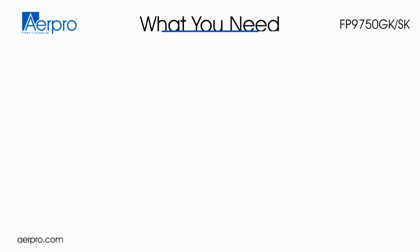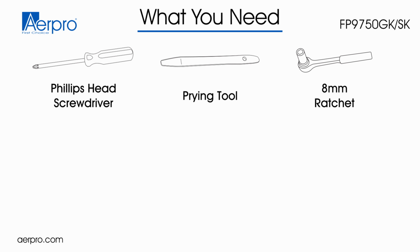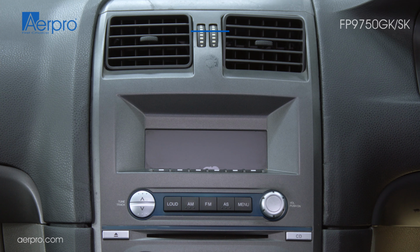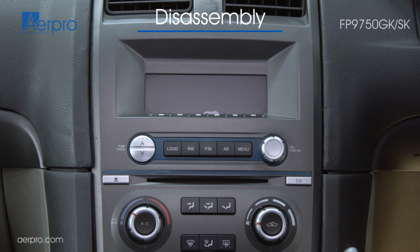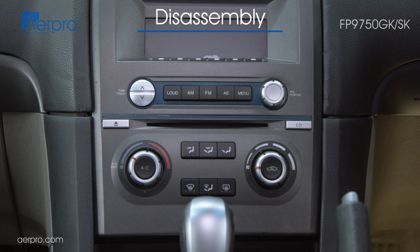If the system is deemed not to be functioning correctly, it is advised to have it fixed before this kit is installed. You will need the following tools to install this kit: Phillips head screwdriver, a prying tool, 8mm ratchet, electrical tape, side cutters, small pick, and cable ties. Lastly, before disassembly, eject any CDs from your factory stereo if applicable, as you will not be able to do so after it is removed.